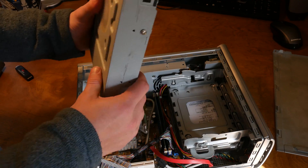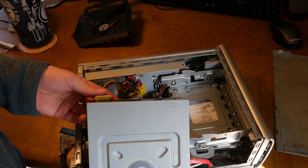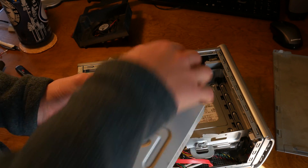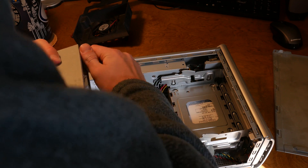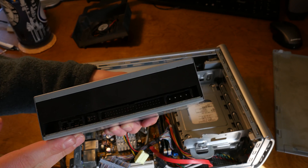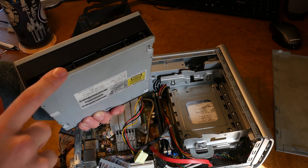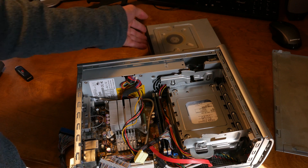The optical drive is coming out pretty easily — just a pretty standard one. Might use this somewhere else if I ever need an optical drive, but I don't right now. So I'm going to try to get this Molex connector unplugged. There we go. As you can see, IDE here, Molex. We've got the controllers for slave and master here, which you have to deal with with IDE unfortunately, but we're not going to be using that at all, so it doesn't matter.